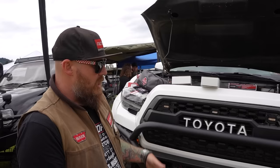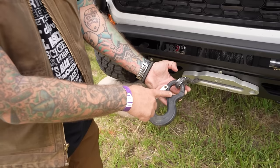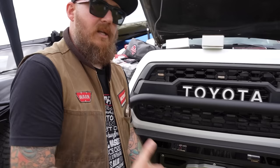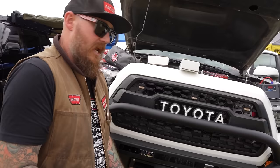Smittybilt — and some other winch manufacturers — do this thing where there's a permanent eye hook on here. The only way to get this off is to put it in a bench vise and cut it twice to get access to the thimble, or you have to re-splice the winch rope. Now re-splicing your rope is very easy to do. We're going to walk through some of those steps and show you how simple it is, and how you can fix your rope on the trail if you ever need a trail repair or want to make your own winch line extensions.